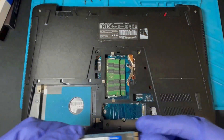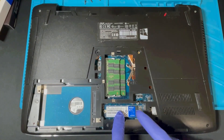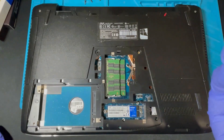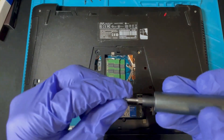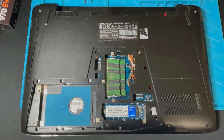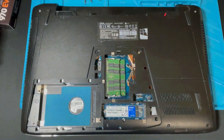Out of the packaging, this is exactly what it's going to look like. Make sure you get the correct drive — this is the M.2 2280 SATA SSD, not the NVMe M.2 SSD. Your laptop should have a screw already installed for the M.2 slot, but this one didn't. I found a screw from my bag of random collected screws — it fit perfectly. I'll put a link in the description for an Amazon kit, but you basically just need one small screw to hold the drive down so it doesn't pop up.